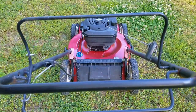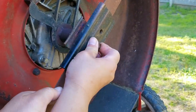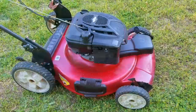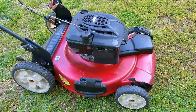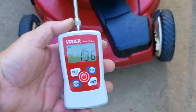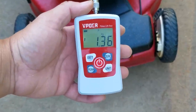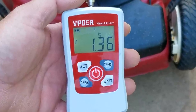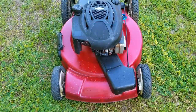As you can see, it appears the shaking has pretty much disappeared, which means our test blade — which was not bent — just confirmed that the original blade was bent and causing the shaking. All we have to do now is replace the blade with a new one and someone's going to get a really good running mower. The last thing we need to do is use the pull tester again to see just how much less force it takes to get this mower to move. All that cleaning and lubricating paid off, because this time we get a very low reading of 1.36 kilograms, which is less than half of the best reading from last time.